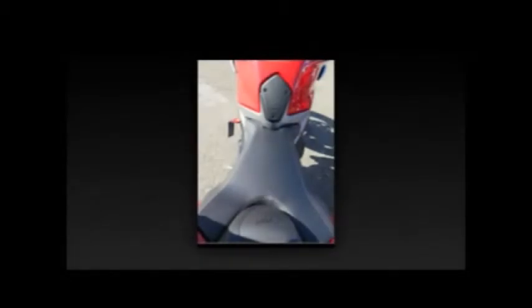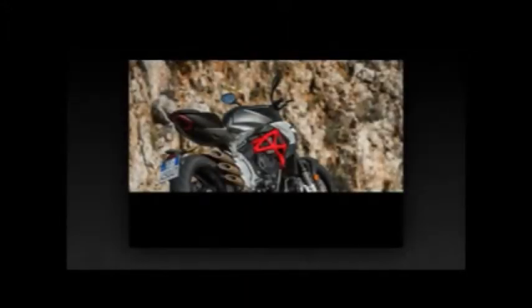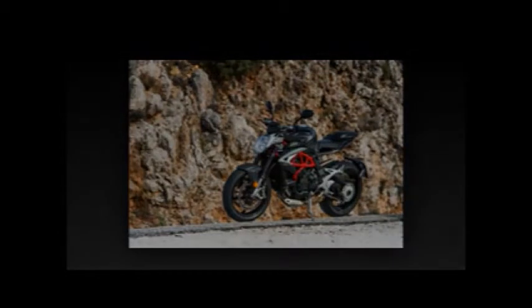Though I'm a big fan of the well-executed downshift, I have to admit it's nice when you're waffling up to a damp downhill corner on an unfamiliar road to just be able to nudge down with your toe and positively know you're going to get a smooth shift and the exact amount of engine braking you asked for. The system doesn't overdramatize with too big a blip, either, like some stupid car that plays engine noises on the sound system. Just enough to mate the gears perfectly. I even took to downshifting mid-corner just for fun, which also never upset the bike.